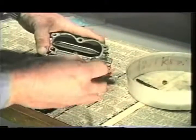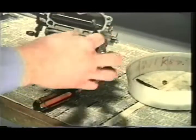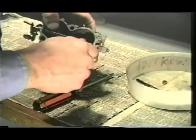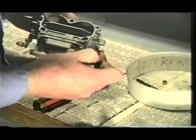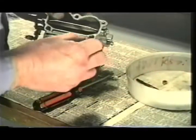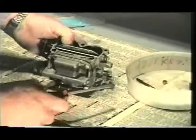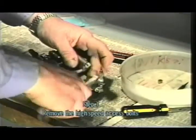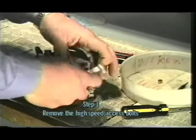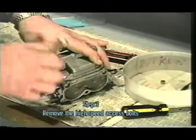You're going to want to replace these seats because one may be real tight and another real loose. This is what seals — you have double threads: the threads inside the carburetor that thread in the needle valve, and then this piece that seals the outside of the carburetor so you don't have air sucking through your needle valves. Now let's go ahead and open up our high-speed orifices and get the little O-rings off them and get them cleaned out.